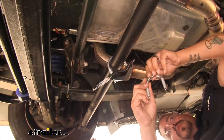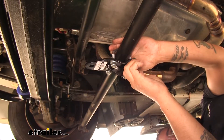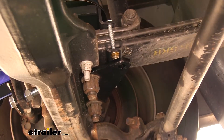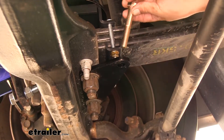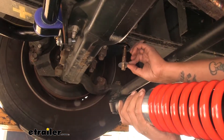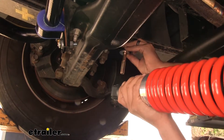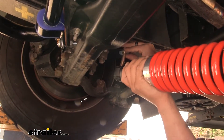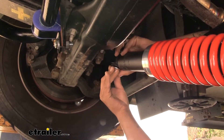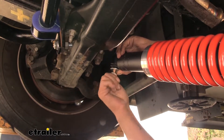We'll have one U-bolt, then put the second one in place and install the rest of the hardware. Coming back to our chassis bracket where the single hole is, we're going to take one of our long bolts and drop it straight down through. Then we'll take a flat washer over our bolt, grab our steering stabilizer on the end that does not have the spring on it, slide it over the bolt, add another flat washer on the outside of the steering stabilizer, and put a lock nut on just hand tight to hold it in place.